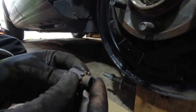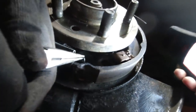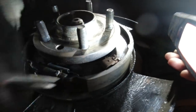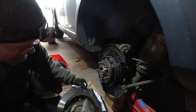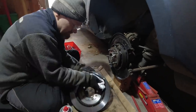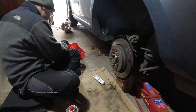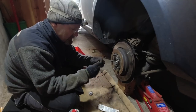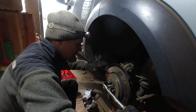The adjuster wheel on the left-hand side goes in like this. Put the last spring in without over-stretching it. Done. We clean the brake pads with a clean cloth and we clean the disc brake. And we put this on. This bolt here was precisely 35 newton meters — I have it on 35. And we tighten this to 35.